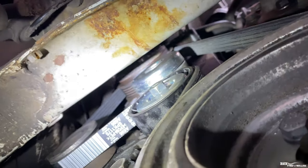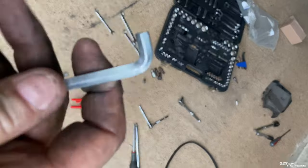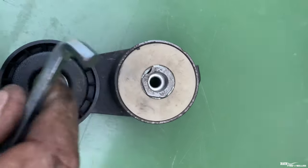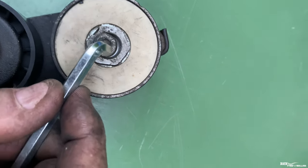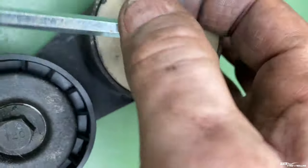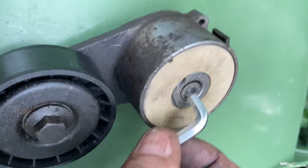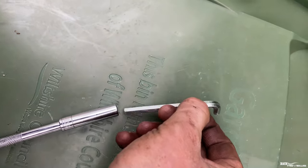What I thought I'd try and do is fashion a tool to get in there. I measured the distance from the chassis member to that bolt, to the tensioner bolt, to this section. And I cut off an Allen key so it was just the right length to be able to fit into the bolt — I fashioned it so it would just fit in there, with enough clearance for the chassis member. Then I put a socket with an extension on the back so I could get this extension over the Allen key for leverage.